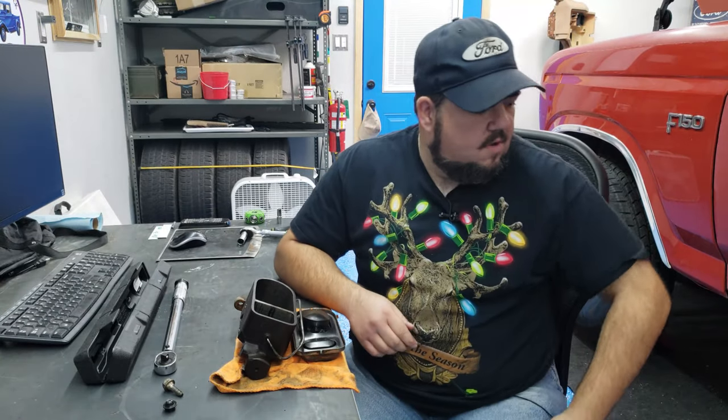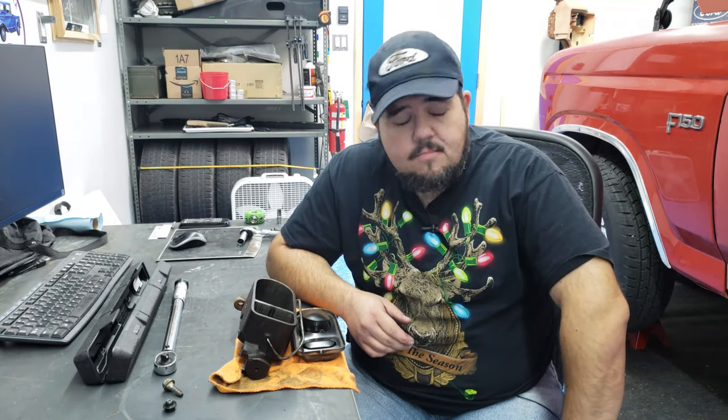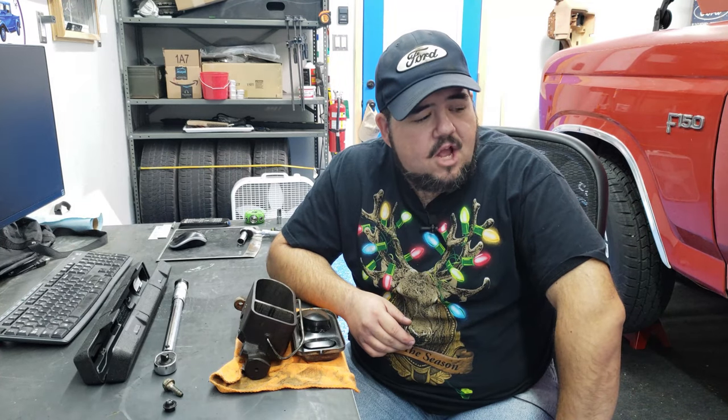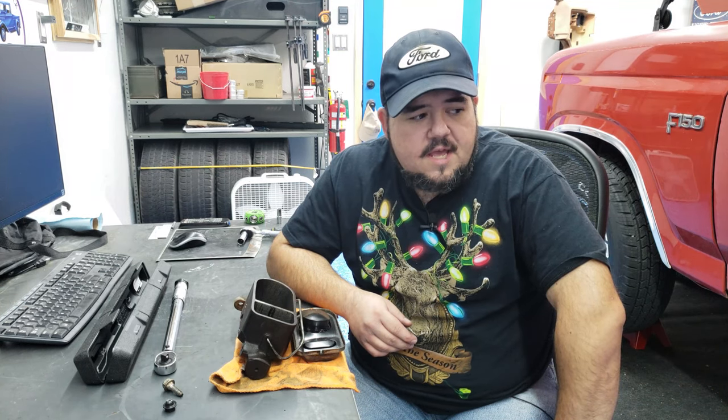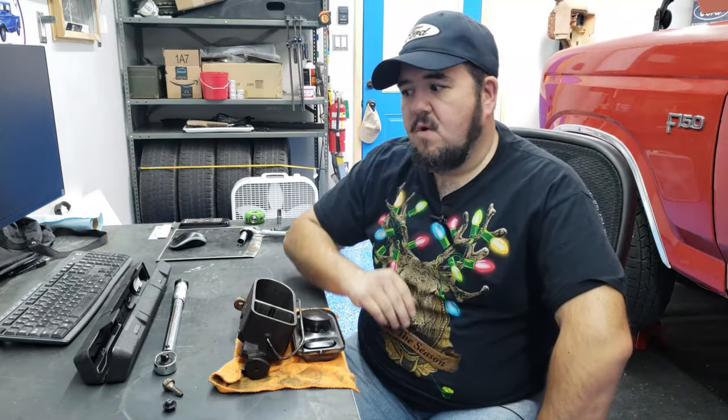Okay, we'll take care of that parking cable and try to get that parking brake situation figured out. In the meantime, I was going back over some of the footage I took of bleeding the brakes, and it didn't look like maybe I got all of the air bubbles out. When you get down toward the end, some of those bubbles are pretty microscopic, and it's hard to see the way that I was doing it. I was using my TV with that sort of phone streaming software, and the resolution just wasn't really high enough to really see the bubbles.